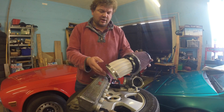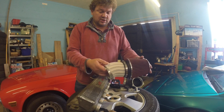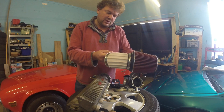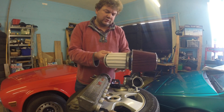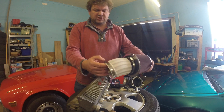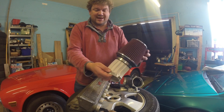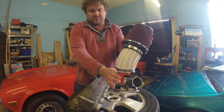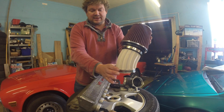This has been on the car. I've measured the temperature up to 70 degrees centigrade and it was still nice and solid, but it's not supporting the weight of the filter — the filter has another point it rests on — so we'll see how it goes. I designed it in OnShape. I thought it was a snazzy-ish looking part. The ribs are to give it some extra stiffness, which is something you can also easily add in 3D printing.